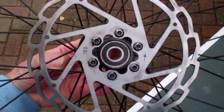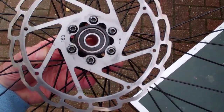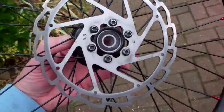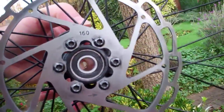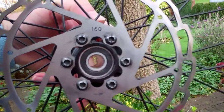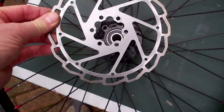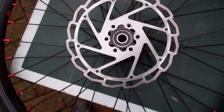When I say it's on the wrong way round — I don't know if you can see the little arrow — that is the rotation it's supposed to go in. But this is the left hand side, so if you can imagine it's going like that, it's actually going the wrong way. If I put it on the other way round then it will be correct and we'll see if it stops the noise.